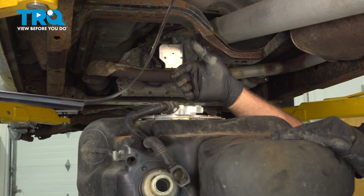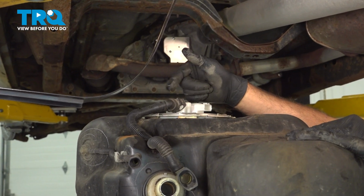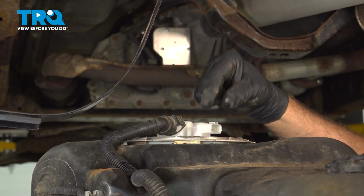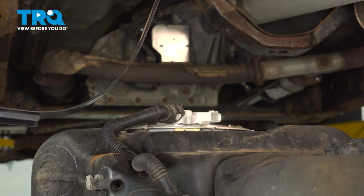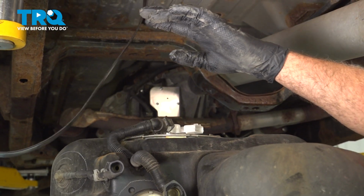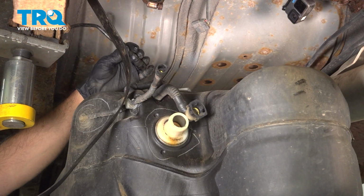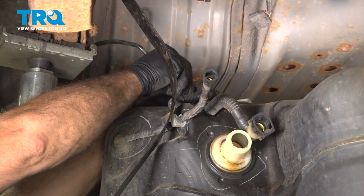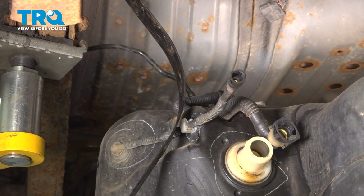Now I want to go ahead and raise up our tank in a position. There are two connectors we need to focus on. Well, one is the fuel line here, the other one is the electrical connector. Once you raise it up about 3/4 of the way, go ahead and connect those two connections. We'll raise it up and install our straps. Press that on, you hear it click.